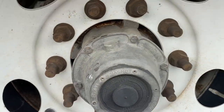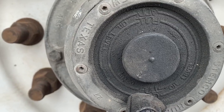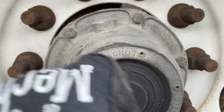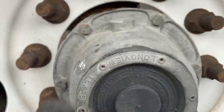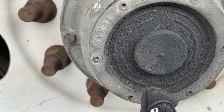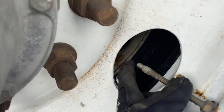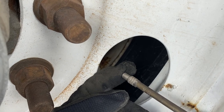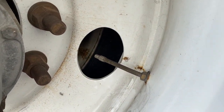The hub oil seal is not cracked, bent, or broken, all bolts are present and mounted securely. The hub oil seal has a cap in place and I would check the oil level to make sure it's full — in this case the window is dirty so I'd need to clean it off with a rag to see where the level is at. The last thing to check on the wheel is the valve stem — make sure it's not bent, it's got a cap in place. The back ones are the same setup as before — they don't need the traditional cap because they have the push button. The cap is in place so we're done there.